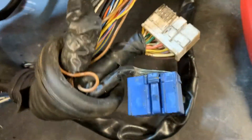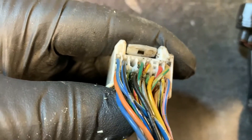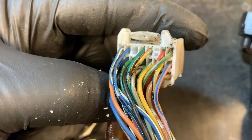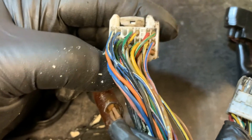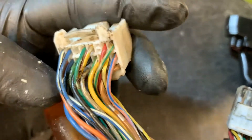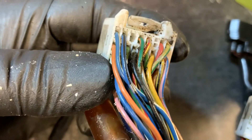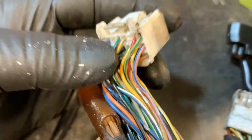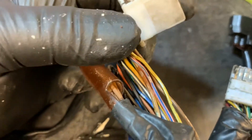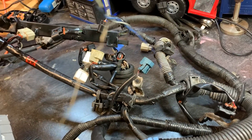What I'm going to do is come to the plug — this is it. There's your blue-and-black and blue-and-white wires, and then there's the gray one. I have access to the wiring diagrams and pinouts, but if you don't and you're in this situation, you can just snap a quick picture and see where these wires go on the GT harness. This plug is pretty easy to take apart and get the pins out — not all that difficult, but it is a little bit of a process. I've got the wires all the way out of the GTS harness.